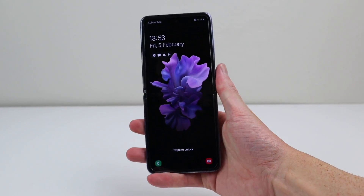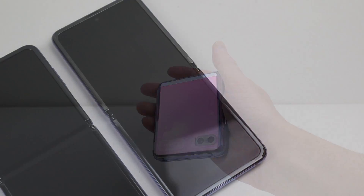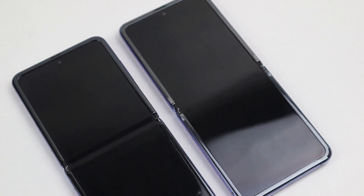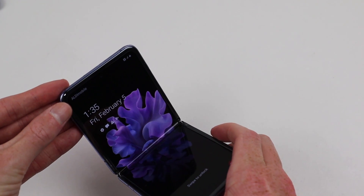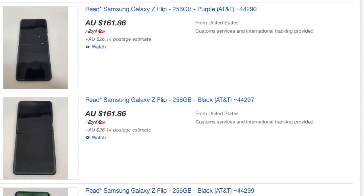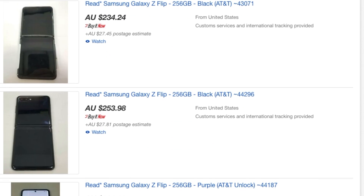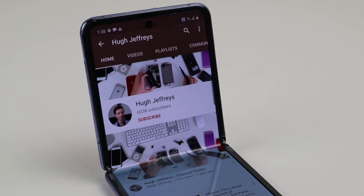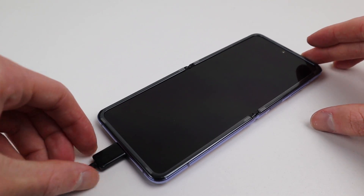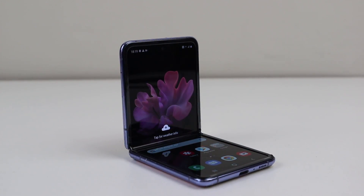Repairing this foldable phone has brought to light some major issues. Parts are not only hard to come by, but extremely expensive. The bigger issue is the technology itself — the concept is cool, but impractical, given just how fragile the display is. Not only does it scratch easily, but they have a tendency to break. A quick look on eBay reveals loads of Galaxy Z Flips with broken screens, most of them damaged where the display folds. I owned another Z Flip, but returned it due to it not reading SIM cards — its display had micro cracks where it folded, which caused the touch not to work in that area. In reality, unless the price of displays massively drops, a lot of these broken foldable phones are just going to end up as e-waste. Foldable phones are kind of like exotic cars — they look nice, cost loads, and are a nightmare when it comes to repairs.